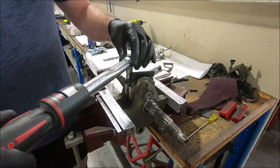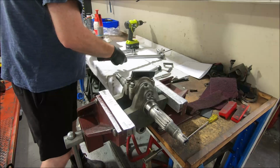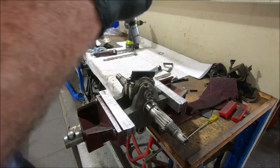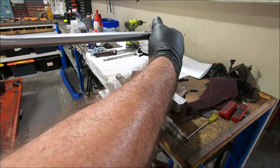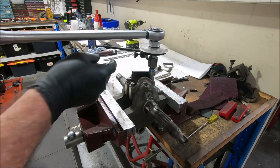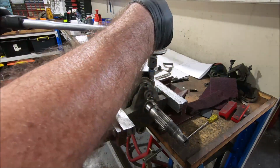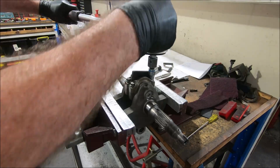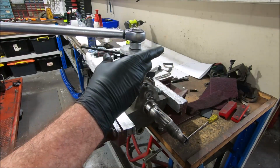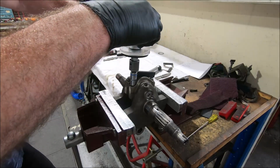I can't replicate a turning torque or turning speed. I'm not that good. And now we go to 65 degrees. What I usually do is just put my tool on and line up 65 along the line of the rod there. I'm going to turn it until the 0 lines up with the center line of the rod. There you go. Once again, set it so that 65 is on the center line. I go around to 0.